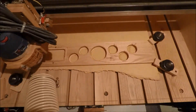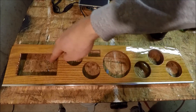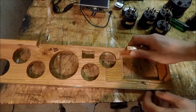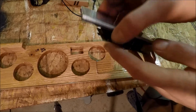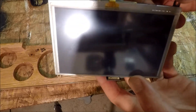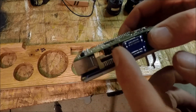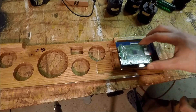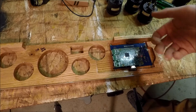There we go, now time to recreate this. Here's the new dashboard. As you can see we've got the hole cut out here for the GPS module. Flip it over — I've carefully machined this so that we can fit our module in there. All I have here is just a 5-inch screen from Amazon, a Raspberry Pi on the back, and a little HDMI connector. See how it's nicely cut out — fits perfectly, and the screen's going to be flush at the front.